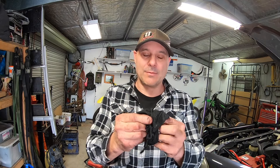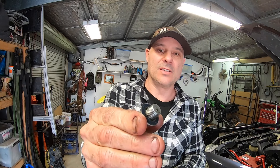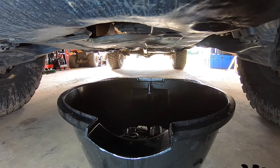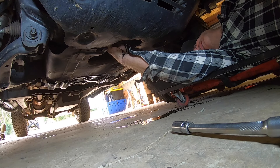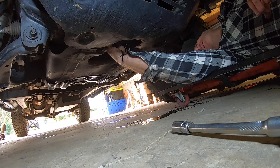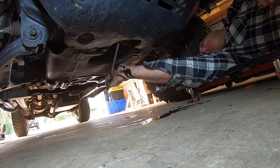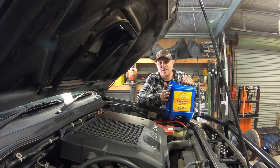Back under the vehicle now. I've got the old sump plug here — give it a good clean up with a nice clean rag, make sure there's no contaminants on it so it'll get the best seal. Also check the seal to make sure it's in good condition. This one is still good. The oil has stopped draining now, so we can easily just put that sump plug back in place and tighten it up. I normally get a little bit of oil dripping when I do this, but when I finish I'm going to degrease the whole engine bay down.